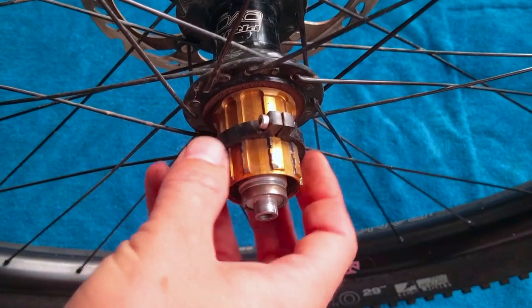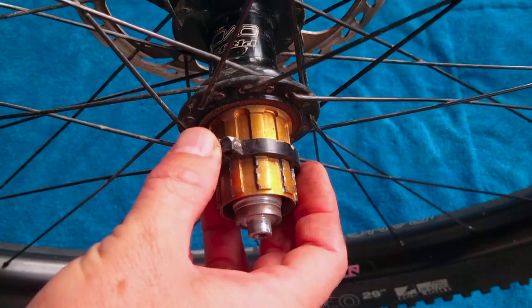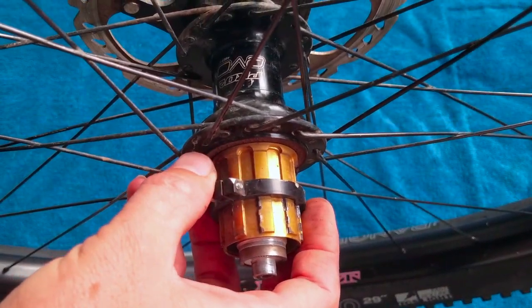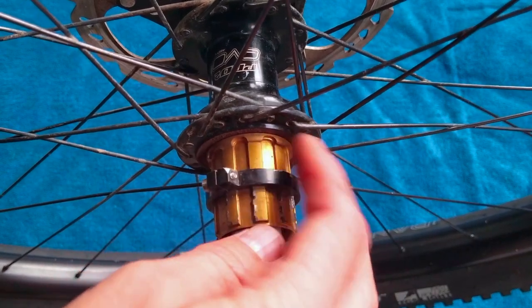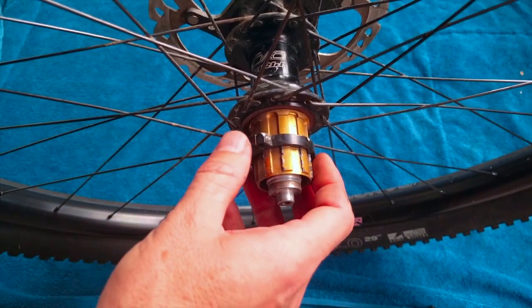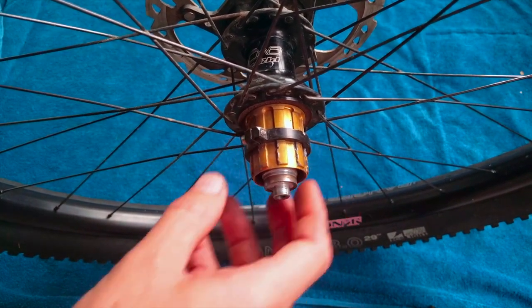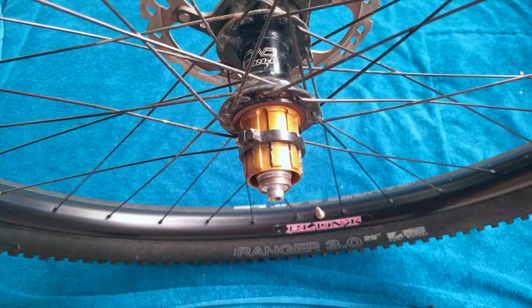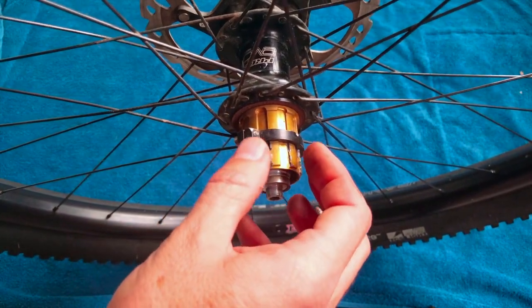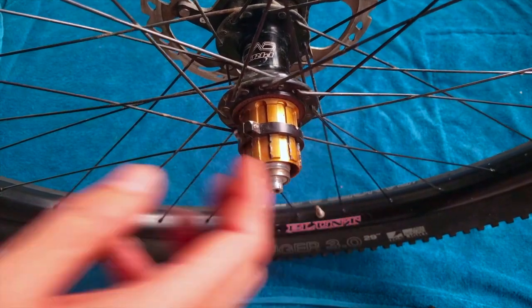Running 32-16 was a little bit too close to these bolts, so I ended up having the chain hit this bolt a little bit. I also had my chain set up a little loose, so I actually threw the chain a couple times, which was problematic. You can see I wore down this corner putting the chain back on — it flew onto the inside. But you can get your chain line really dialed in with these; it's kind of infinitely adjustable. You can move these gear clamps wherever you want — it's not constrained to one, two, or five millimeter spacers.